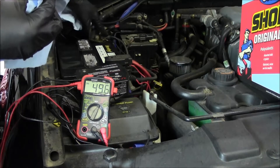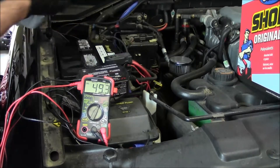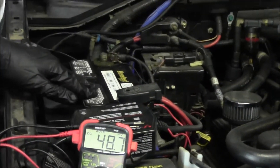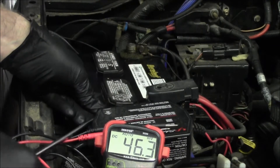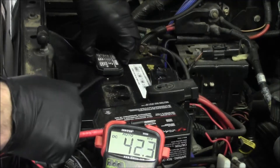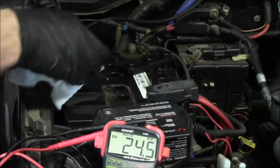The best way to do this is to completely disconnect the battery and use the terminal brush. I'm going to pop these caps up and check the water level — using a long-handled screwdriver to gently pry them up. Look at all the garbage in there. Just want to gently pry up, don't want to go gorilla on this stuff. Then I'll try to wipe it without dumping anything into the cells.